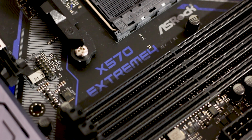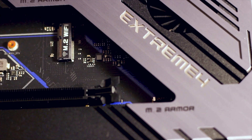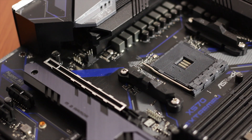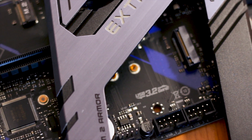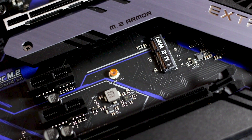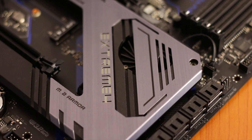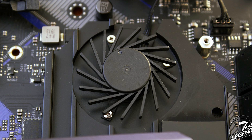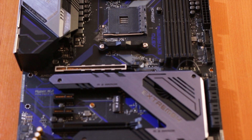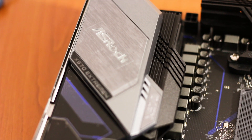Taking everything into consideration, the ASRock X570 Xtreme 4 is a good motherboard for its price range, offering plenty of useful features for overclocking and daily use, along with design elements that help it stand out. It includes two Hyper M.2 sockets with passive cooling, an E-Key M.2 slot for Wi-Fi or Bluetooth, and a chipset fan that is barely noticeable under normal conditions. Performance is very good in both synthetic benchmarks and gaming, and build quality is great — the only cosmetic-only plastic element being the I/O panel cover.